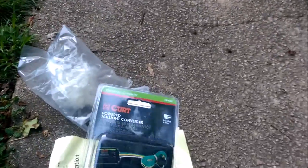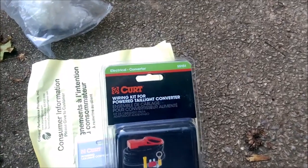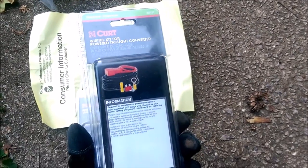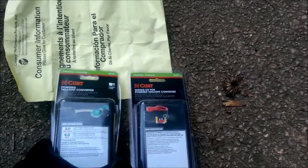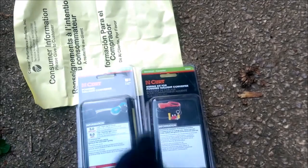So, the instructions. We also got the powered light circuit with the converter that attaches to the battery terminal. This just splices into all the brake lines and turn signals in the back. It doesn't go through the Saab wiring harness at all. Didn't want to deal with that, even though you do get the better alerts on the SID — but didn't think I needed those.